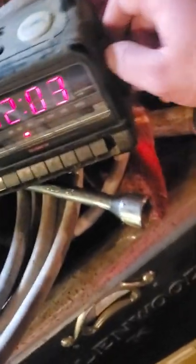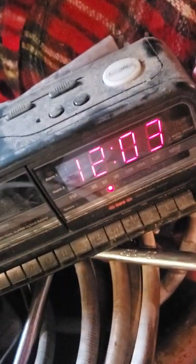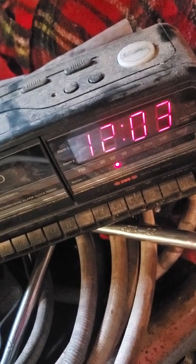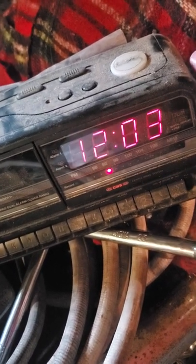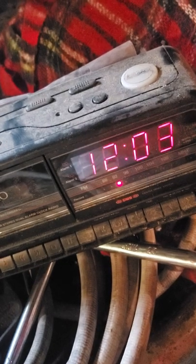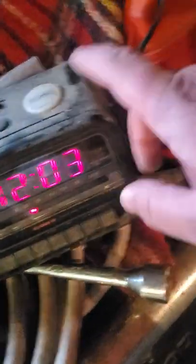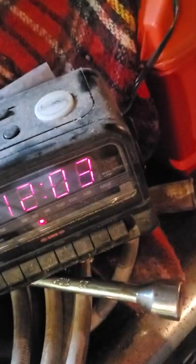That's the volume. This is the volume and this is the tuning. That noise means this switch is dirty inside. If this was taken apart, you could drill a tiny hole in there, spray some WD-40 in there — I've heard that often fixes the problem.